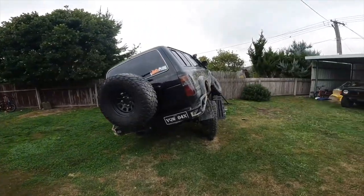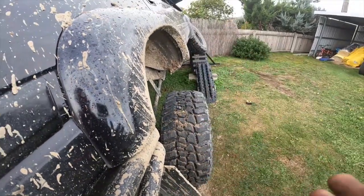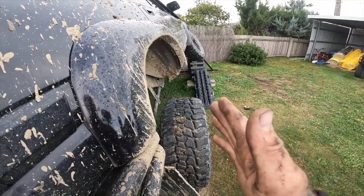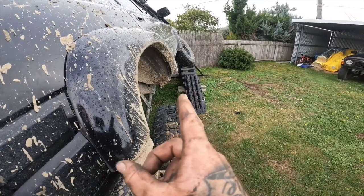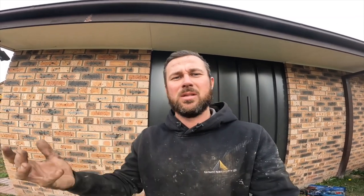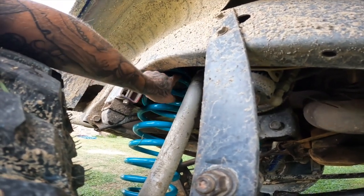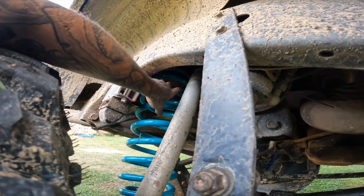Another thing I'll explain while I'm here looking at the car: long arm kits in the rear of Patrols — anything coiled — is exactly for this. If you look at the direction my wheel is pointing, it's called rear steer. What happens is when you start to droop down, it turns your wheel so you steer in a different direction. When you put a longer arm in, instead of kicking that way it might kick it more straight with the vehicle. It's good for obviously real long, hard technical tracks. It's quite a big bit of rear steer, which can just put your rear end off the correct line and put you in a bit of a sticky spot sometimes — you just gotta learn how to drive and steer with it as a standard car.